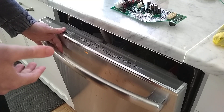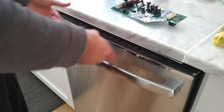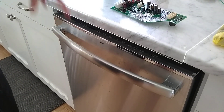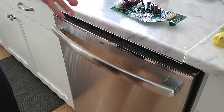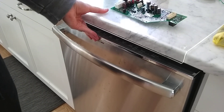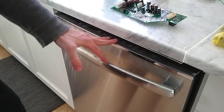If I pick a different mode and do start, it's able to detect that the door is open or not. If it was working properly, it would turn on the pump that pumps out water from the dishwasher or spins around — I'm not sure, it's in the service manual. But I don't think it's detecting that the door is closed. Suffice it to say, this is one way that it didn't work.